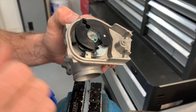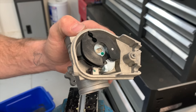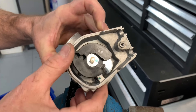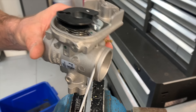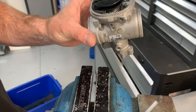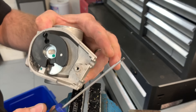Whatever you do, don't try and just unscrew the grub screw because the loctite is very firm and there's a big chance you will damage it, making it a much bigger job. What you need to do is heat this whole area to break down the loctite, and then once the loctite is broken down it's quite simple to unscrew it. You'll notice there's a plastic part here which holds the cables — obviously we don't want to get heat into that because it will damage. So the sensible thing is to heat from the backside, which will heat up the aluminium around the loctite and break it down. I'll mount the throttle body in the vice and gently start heating from the backside. This is a 2.5 millimetre Allen key — I've cut the end off so it's nice and square, because a ball end can strip out more easily. Make sure you remove any dirt or grit that might be in here, as that can strip out the grub screw. Once everything's clean you're ready to heat up the throttle body.